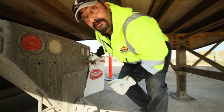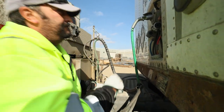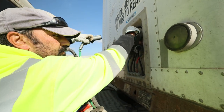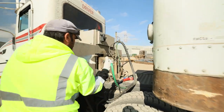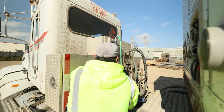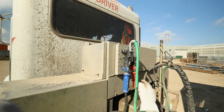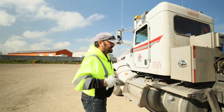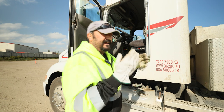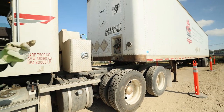Everything's good here — jaws look close because of the Holland style, but they're disengaged. I'm ready to exit. I'm going to disconnect the blue service line, my red supply, and my electrical. Very important — not to grab the cord. Don't wiggle. Lift the little flap on the locking plate on the trailer and just slide out straight. I'm now going to safely hang them into my holder.